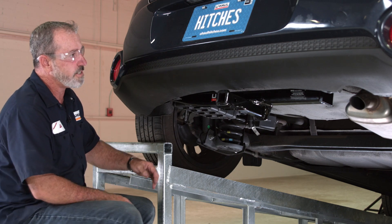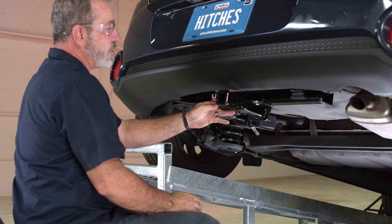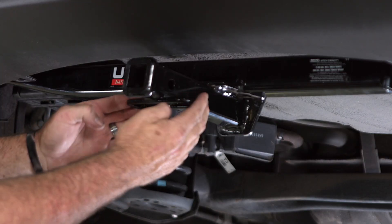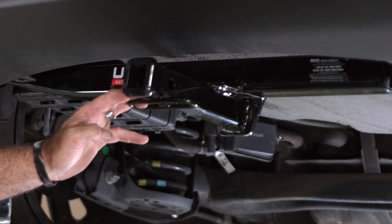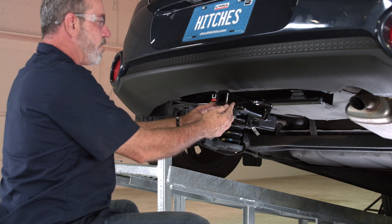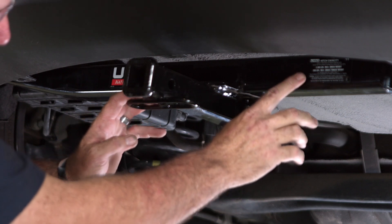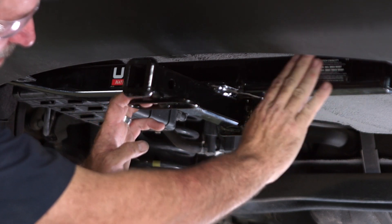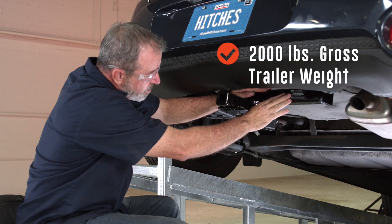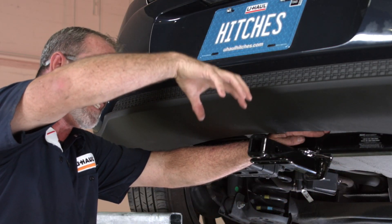Let's take a look at how this hitch turned out. You can see that the cross tube is well hidden behind the bumper fascia. The only things you can see are the inch and a quarter receiver tube and the safety chain hooks. One other feature is the half-inch attachment hole for a pin and clip or any locking device for hitch accessories like a ball mount, cargo carrier, or bike rack. The hitch weight ratings are on a sticker here: 2,000 pounds max gross trailer weight and 200 pounds gross tongue weight — tongue weight being what's put in this area right here.